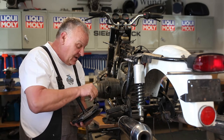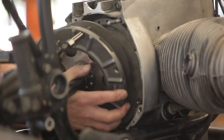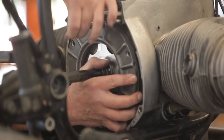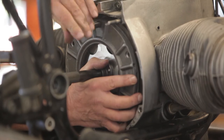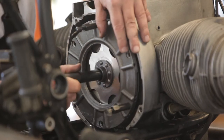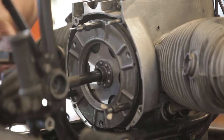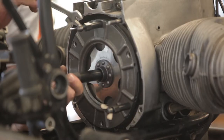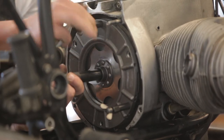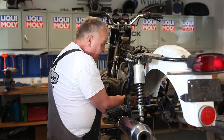This is where we need to use these special tools to install the clutch. I'm going to stick one in there like so, get my spring put in there, and get this one started. Holding the clutch in center position with the tool, now comes the tedious task of tightening all of the tool bolts to bring the clutch together and compress the spring.